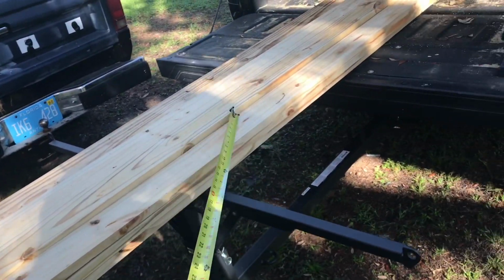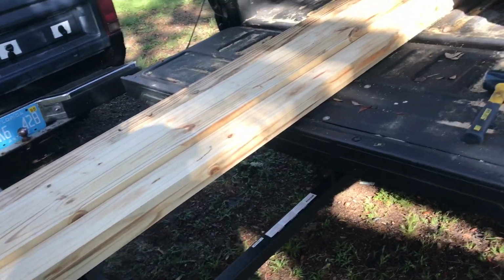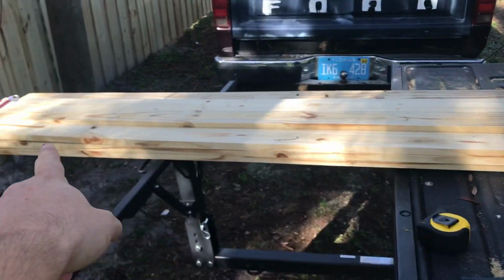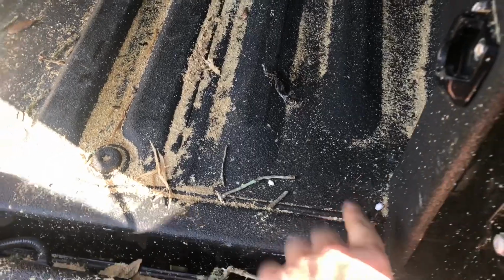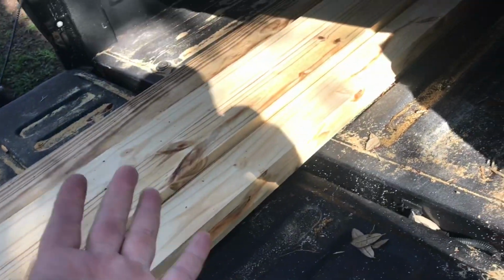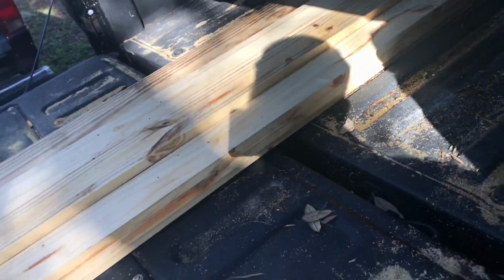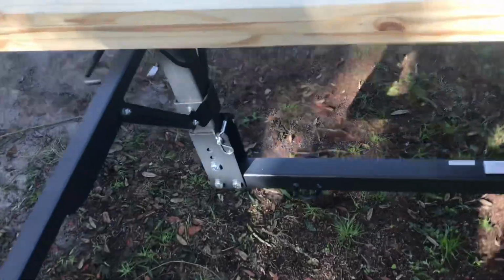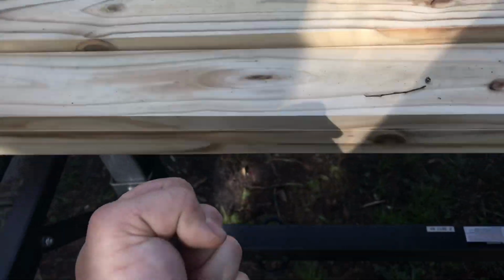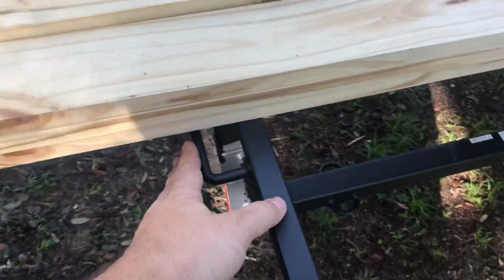So the biggest thing to take away from this is the tie down point. When you run a load out without this on here, and it's coming out all this way, especially on the Tundra, without installing them aftermarket, my Ridgeline had them, there's no anchor points down here. So you cannot run a strap over the top of the lumber and cinch it down tight to the bottom of the bed. You really kind of are limited. You could go under the tailgate, obviously, start ratcheting down here, you start screwing up the body, it's a bad thing. Here, you can ratchet from these points over the top and then back down, create a real strong hold on there. You could also add some reinforcement back here.